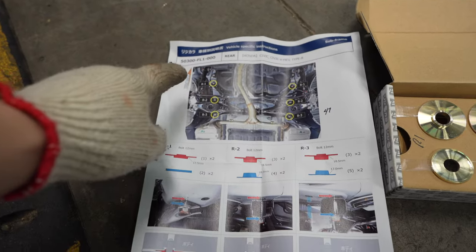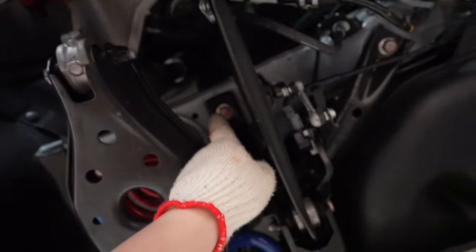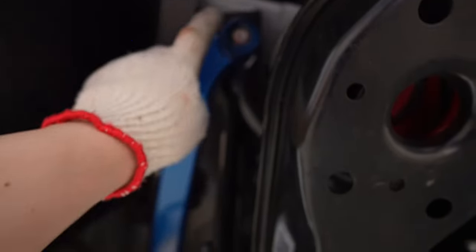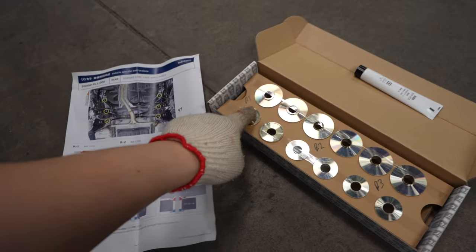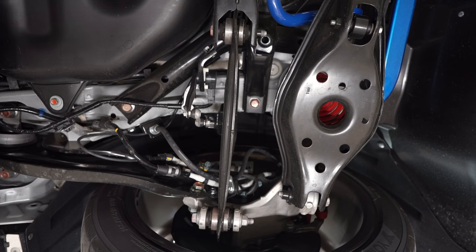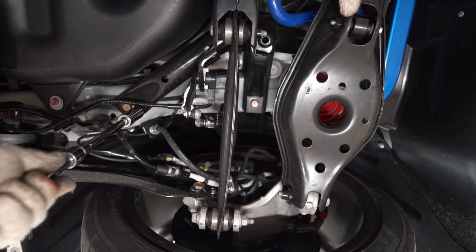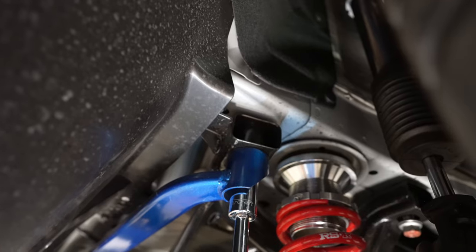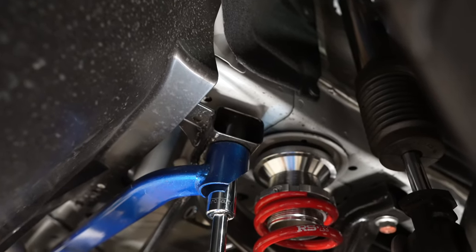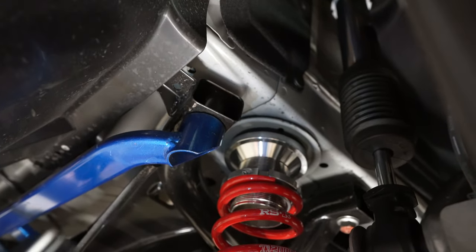Based on the orientation here, R1 is this one right here — this is the front of the vehicle. R2 is this one here and then R3 is this one. I have the Cusco brace but it's identical, it's all the same. So the game plan: I'm gonna start loosening all these — they're all 17 mils — just enough so the subframe drops down. You are not gonna take all the bolts out all the way, just loosen them so it'll sag.